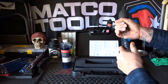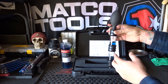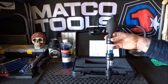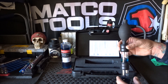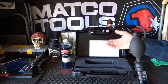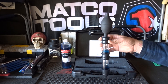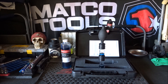One more thing before using this: if you do not have a combustion leak, you can actually reuse this fluid, though it's not recommended. You can reuse it as long as you pour it back in the bottle as quickly as possible. If the test fails, you know you've got a leaky head gasket. If it passes, just dump the fluid out — you can always buy new fluid.